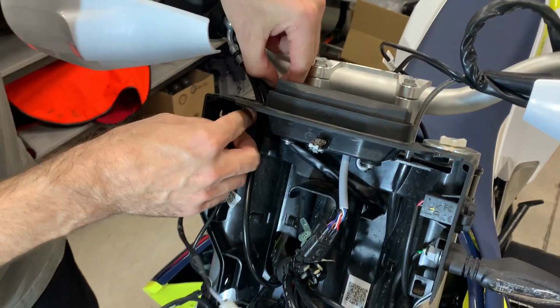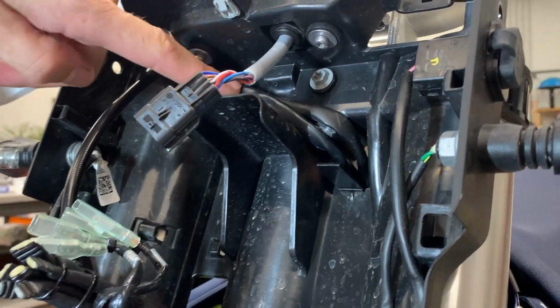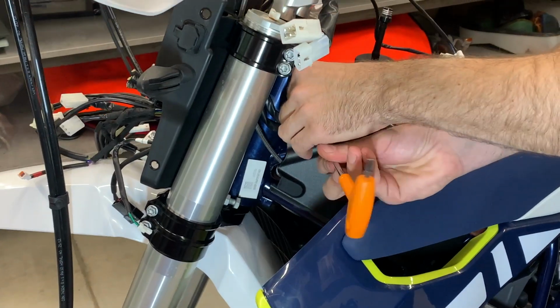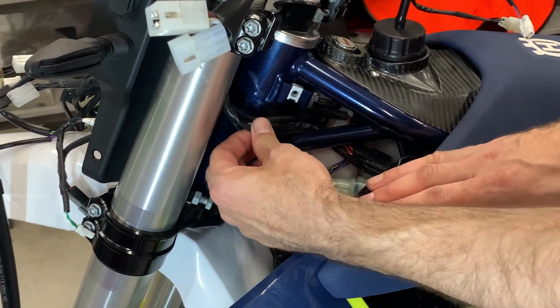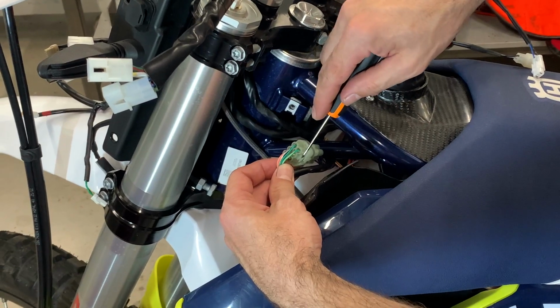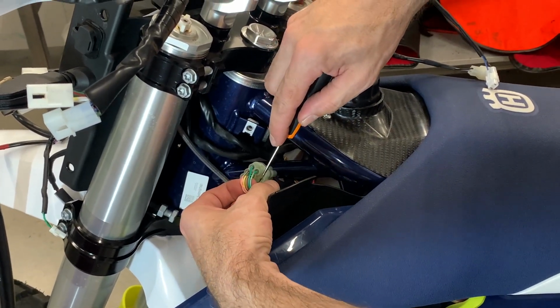Now you can get out this one. And last thing, what you need to release from here are 2 cables going from the gas. The connectors for gas are behind this black plastic. So just take out this bolt. You open it, you pull one of the cables, you see this connector. Here you need to take a screwdriver, and here is a small tongue, so you lift it up and then you pull out.